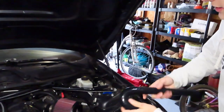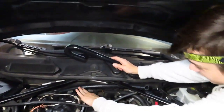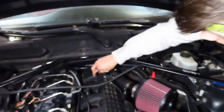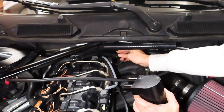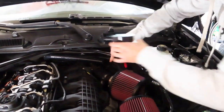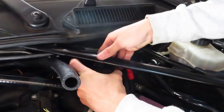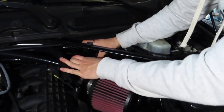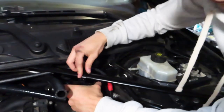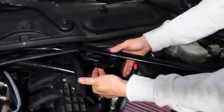This hose is going to go where the hook part fits into this fitting over here. In order to get this one in there, I unplugged the connector that goes on the fuel rail. Now you just take your catch can, install it — check out Burger Tuning at burgertuning.com. Pretty much all you want to do is get this bracket around here and then tighten the four-millimeter Allens to get the catch can mounted right here.